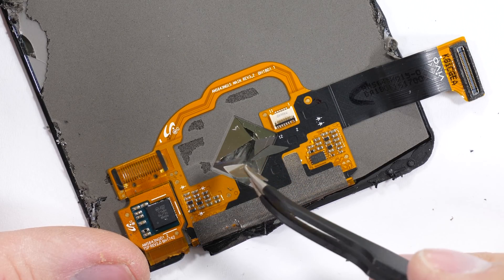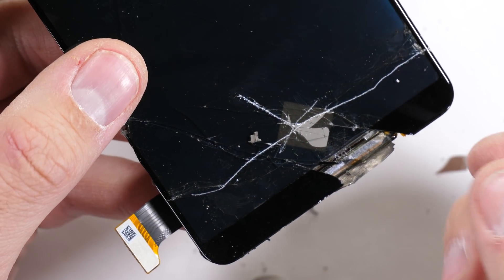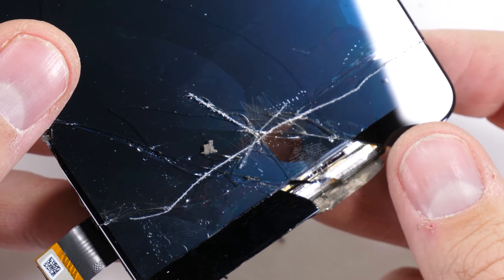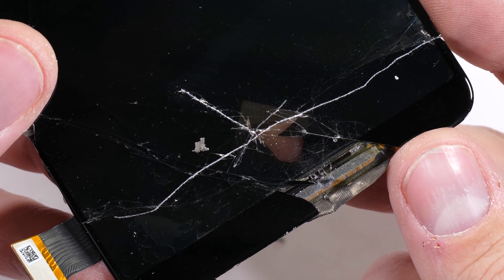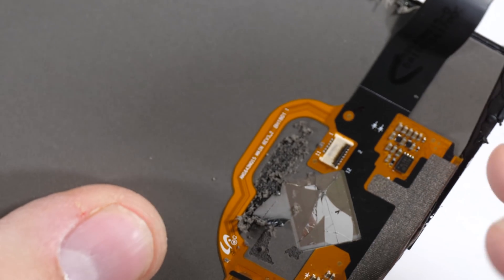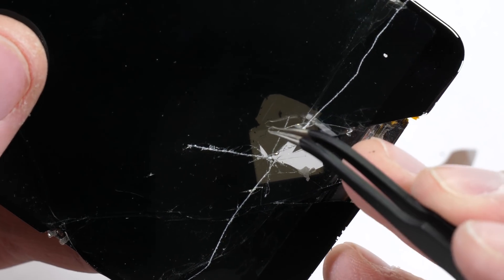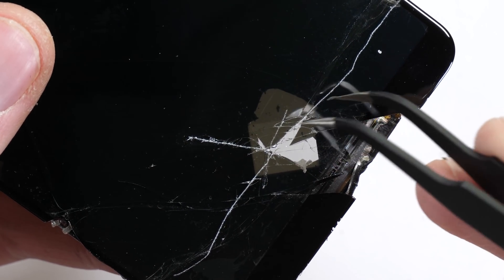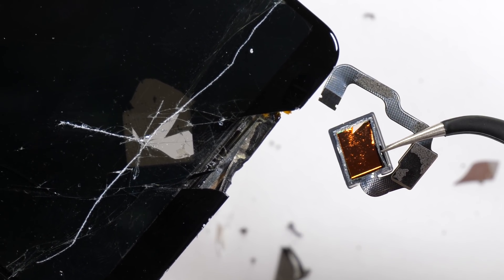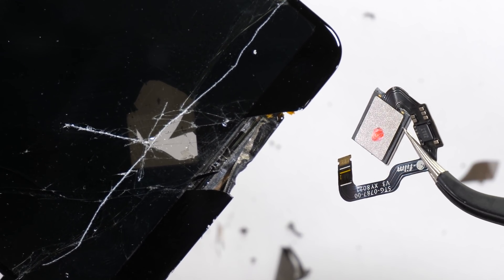Let's take a closer look at the display panel, since the fingerprint scanner essentially takes a picture through the LEDs displaying the images you see on the phone display. The shards are semi-translucent, and you can see light through the rectangle where the sensor used to be. The only reason the rest of the display is as black as it is is because of this black layer of tape covering the AMOLED panel. Without this black layer of tape, the rest of the panel becomes as translucent as the little rectangle above the fingerprint scanner — confirmed by the translucency underneath the tape that I peeled away. Like MKBHD said in his video, you really can put that fingerprint scanner anywhere and make it as large as you want since it just works underneath the LED panel.